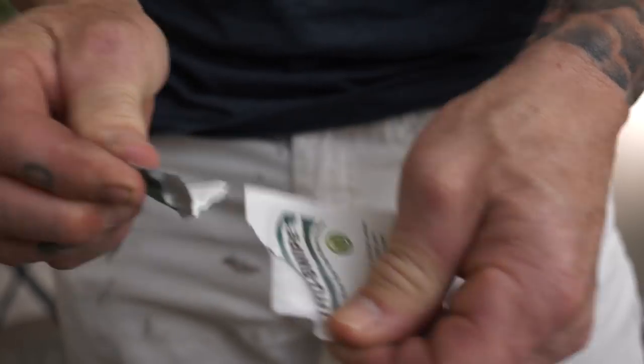The first product we're going to talk about today is True Swipes, created by Chad Flood in San Diego, California. His painting business is called Local San Diego Painting Company, and his product company is called True Green Products. This is a very simple little wipe. What it does is tell you whether you have oil-based or water-based paint on your surface — and it's very important to know that because you've got to prep properly.